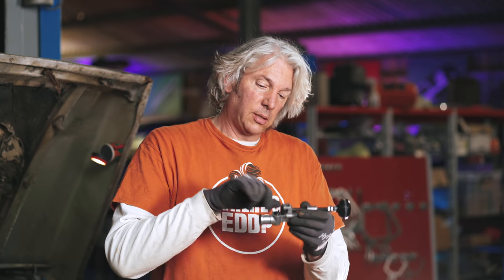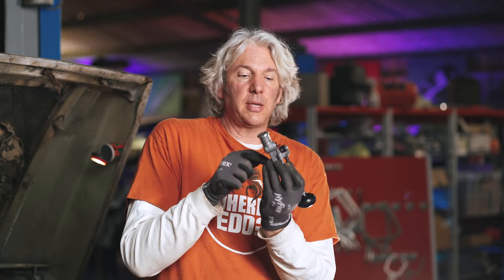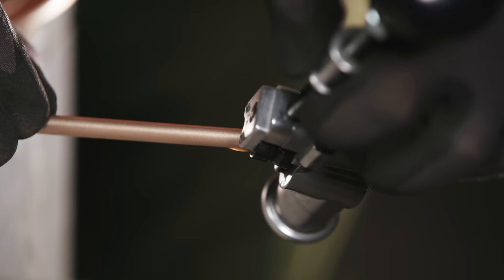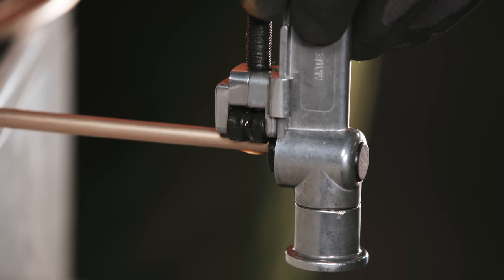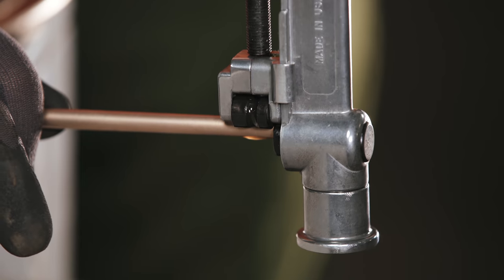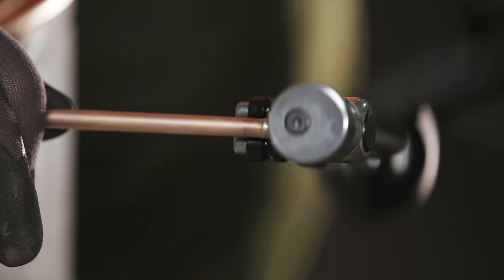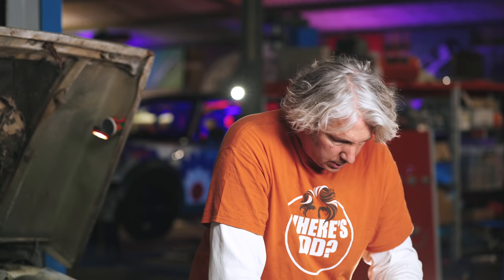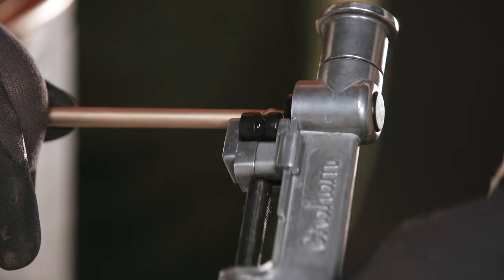Next, a little bit of lubrication. You can see the beading tool has almost like a little finger that pushes on the inside of the tube, and these rollers support the other side, with a little dip in them — that's what creates our bead. I just pop it on and wind the handle to bring the finger and rollers together, crank it down, and start moving it around. Each time I wind it a bit more, it deforms the metal just a little bit more and I can see the bead starting to form.